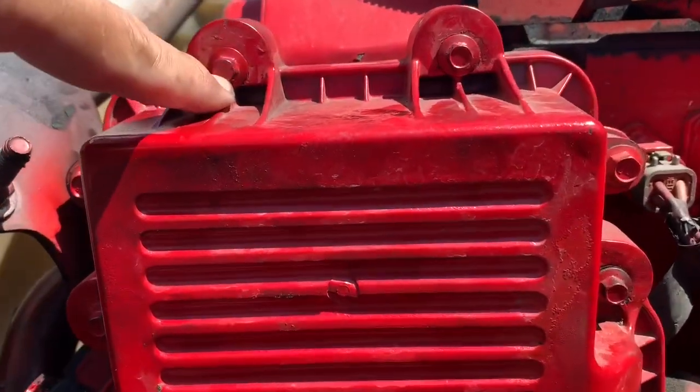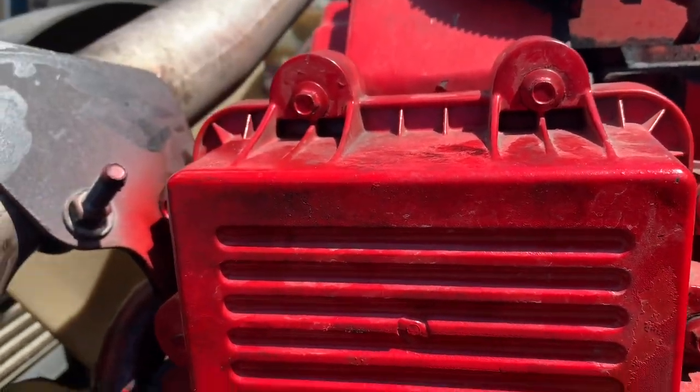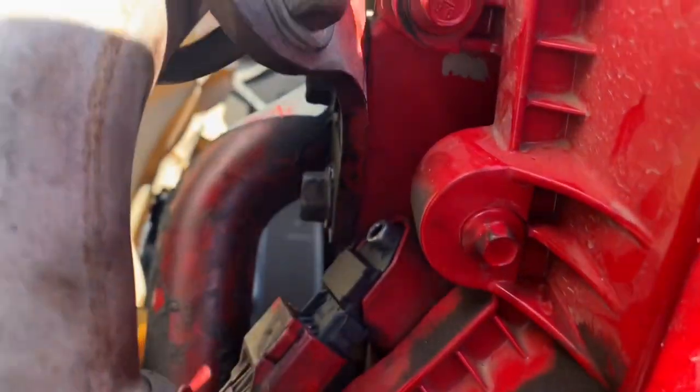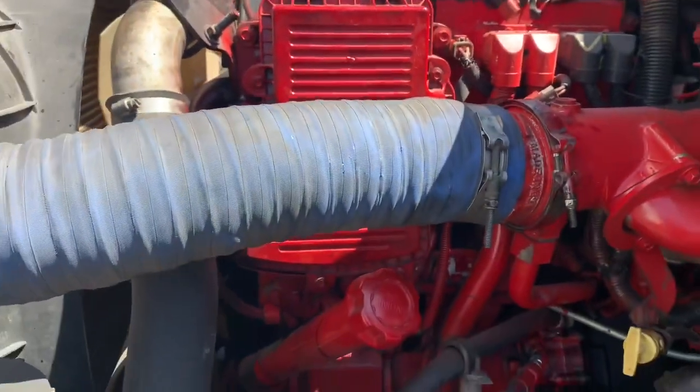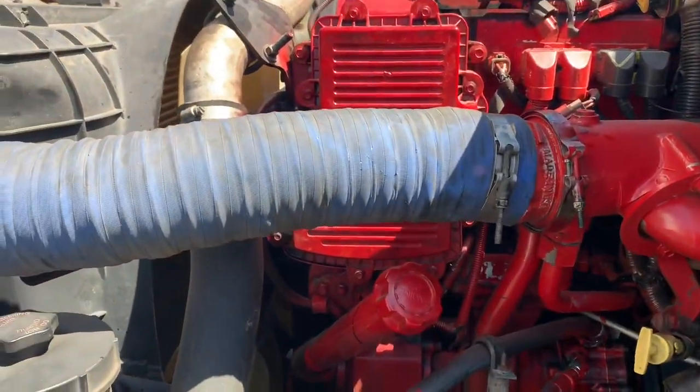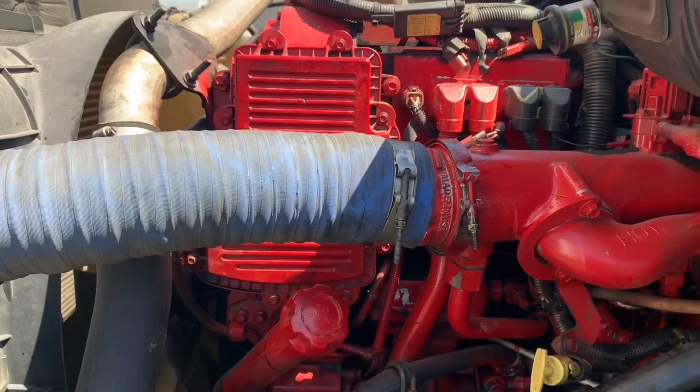This is torqued down to something in inch-pounds, which is almost nothing. That is the little bolt that holds down your crankcase sensor, and you're done. It should clear the code itself. If not, you can use your Insight software to remove that.